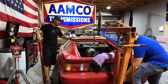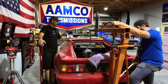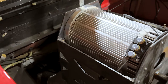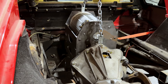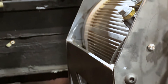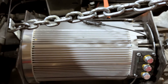Kind of a big deal right here — we are doing the first fitment of the motors and transmission. They're officially all mated together now. We've got clearances on our clutch, and when you turn the motor we turn the axles. So kind of a big deal there. Now we're just fitting it because we've got to fabricate some motor mounts, and it's just a lot easier to put the motor cradle where it's going to be. I've got my level here, and from there with the distances we have — both height and width — we'll be able to cardboard engineer some motor mounts that'll fit perfectly.